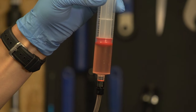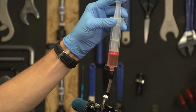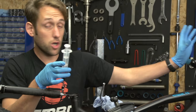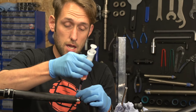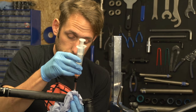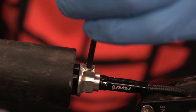We've flushed through several times and the bubbles seem to have disappeared. We're going to force the fluid from the seat post up into the remote so we can continue bleeding from the remote end. Now we have the majority of the fluid up here in the remote. We can remove the syringe from the seat post and replace the bleed screw. Have a bit of rag on hand to catch any fluid that may drip out, then carefully replace the bleed screw. We've finished with the seat post end now.